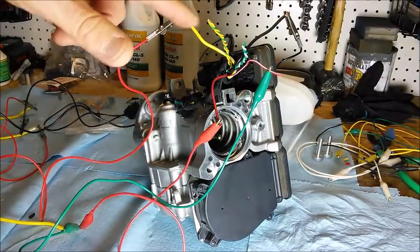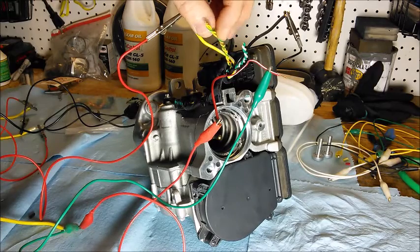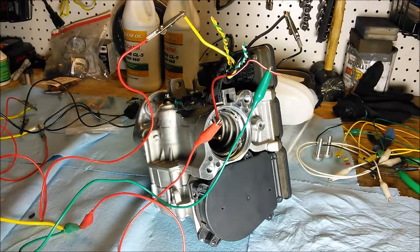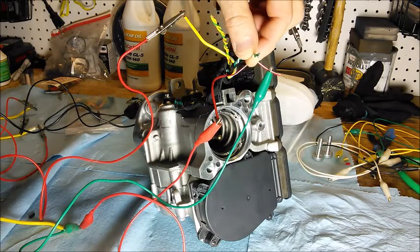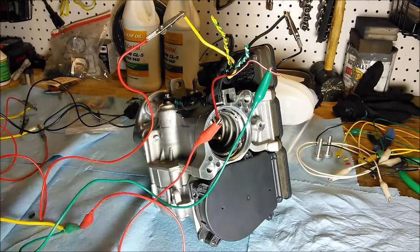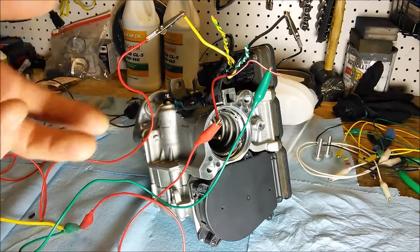These other wires here are a CAN bus that runs to the yaw sensor. It's dedicated to the yaw sensor, which is located in the middle of the floor pan of the Tesla. And then this CAN signal runs to CAN bus 2. So essentially it's operating right now in fail-safe mode.